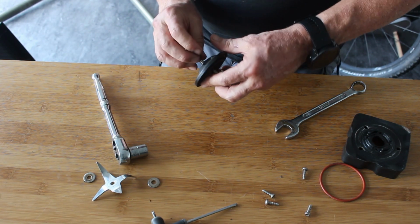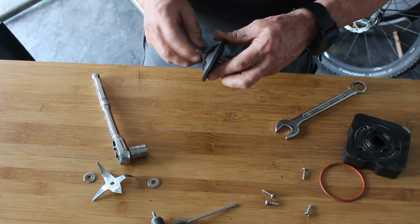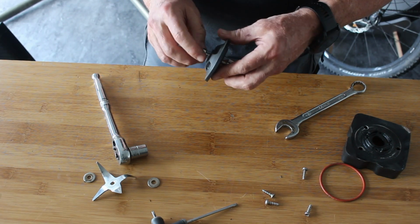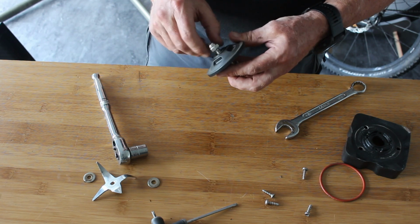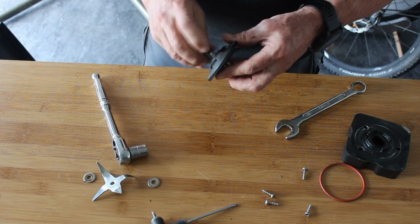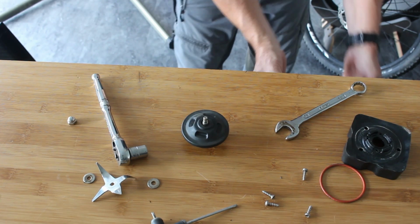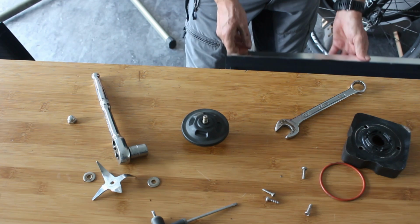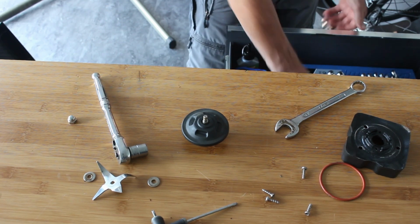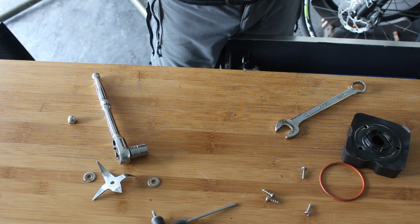The washers aren't keyed to the shaft either, and because it's a left-hand thread, as it's spinning, it will naturally tighten up if it needs to. But it does need to have some element of slip. So if it does hit something solid, it won't just stop everything dead. There will be a little bit of slip before the motor stalls out. That's my theory anyway. So again, that's probably another reason why you don't want to be over tightening it.